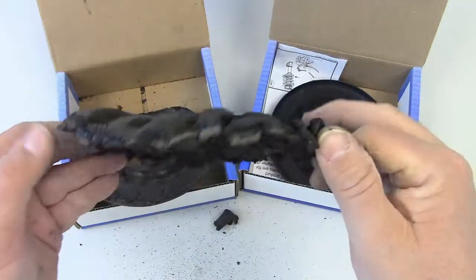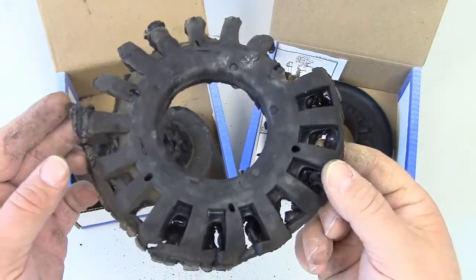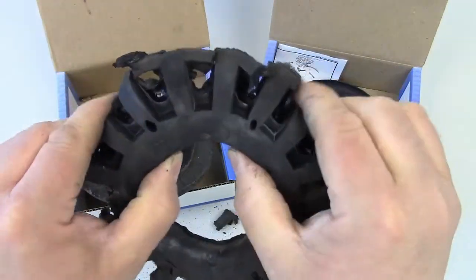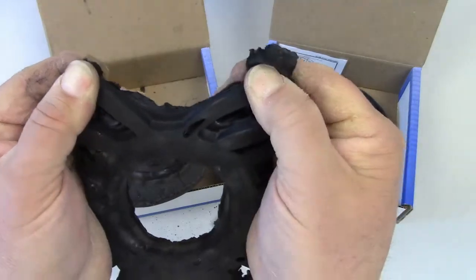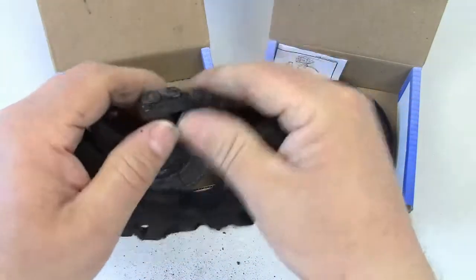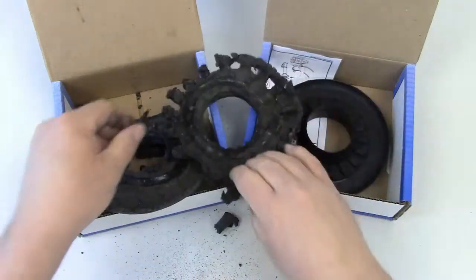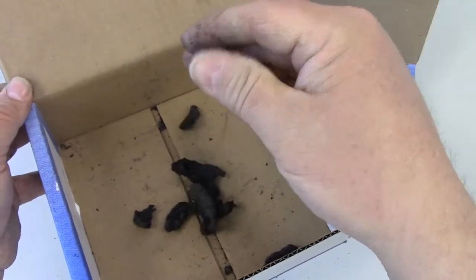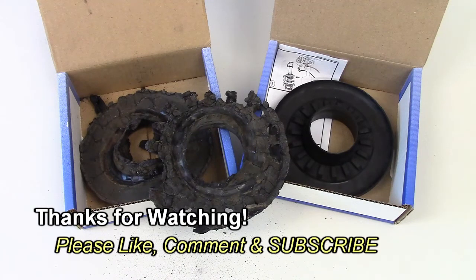At first glance you might think this is caused by excessive heat, as if something under the vehicle got so hot that the insulators started to melt. But I don't think that's it — I think it's the compounds used to mold the rubber in the first place. They probably used too much of one component, causing the rubber to break down over time and get so soft that it started to melt and get sticky. That's why there are all these pieces left over laying on the bottom spring. If you have any questions or comments, post them below, thanks for watching, and if you like my videos please subscribe.